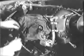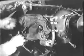Whenever you tear an engine down, you have to be sure each part goes back in its original position. There are so many identical parts that you can't remember where each one goes, so tag it as you take it off. Metal identification tags are best because you can dunk them in cleaning fluid and the number won't come off. As soon as the cylinders are pulled, be sure you cover up the open cylinder port so dirt, loose wire, nuts, or tools can't get inside accidentally.